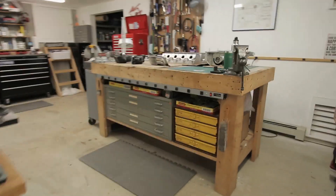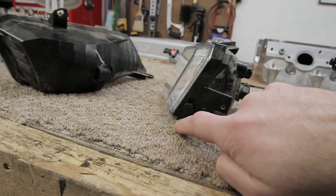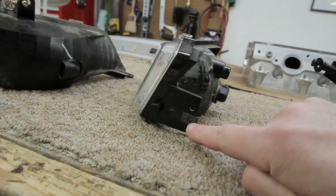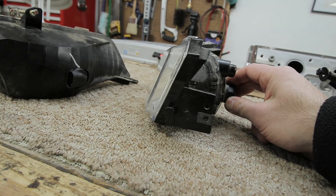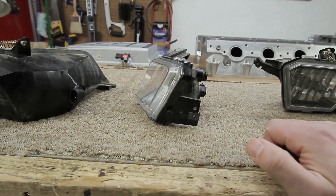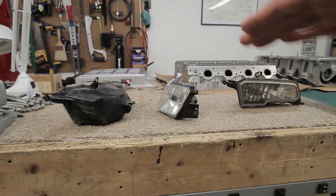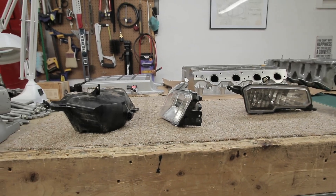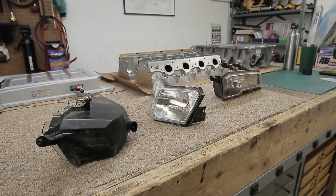Underneath the cover it's a very simple system — it pivots, there are two elastic bands on the sides, and you loosen that post to adjust it up and down. There's a bracket attached to the handlebars, and tightening the screw locks it down to that bracket. For the high beam it's just a matter of getting the set height right and projecting it out 50 feet — I'll probably aim for a two or three inch drop for good forward projection.